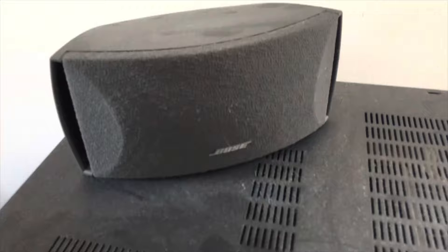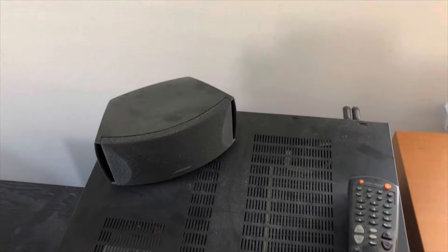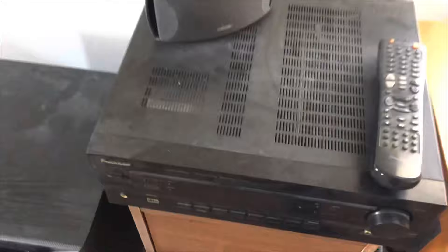Here's another type of Bose speaker. This one also has custom cables that I had to make for it — as you can see, there are four wires coming out the back. There are two drivers, so it's got one pin for the positive and negative channels of each driver, and they alternate: positive, negative, positive, negative. I've taken the positives and negatives, put them together into one wire, and ran them into the speaker wire and into the channel on the standard receiver — sub out for the sub as well — running 2.1 channel. It works pretty well. Just make your own cables for these Bose speakers and they will work with whatever receiver you want. That's all for today — hopefully you found something useful, and feel free to like and subscribe.